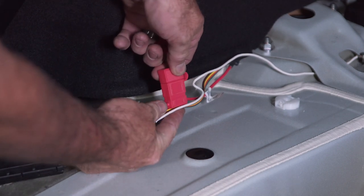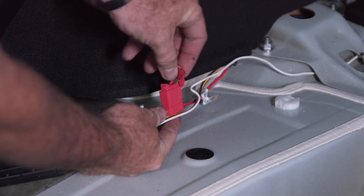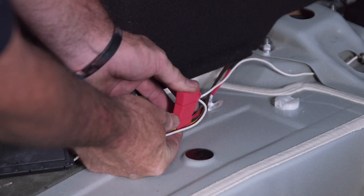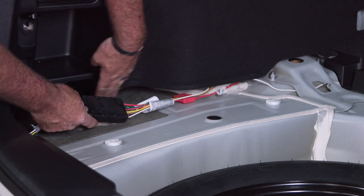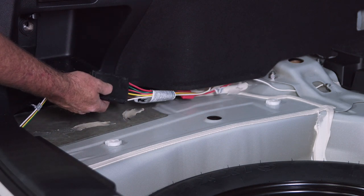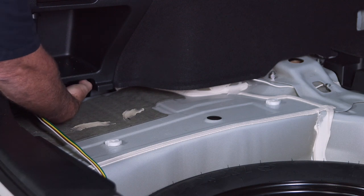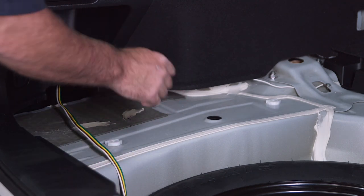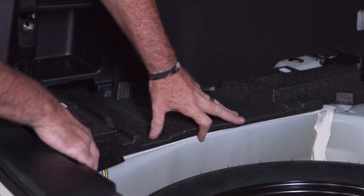To give our tow harness power and get it activated, we're going to put in a 10 amp fuse in the fuse holder — just lifting up the cap, plug it in, close the cap, and our plug is activated. Normally we'd put double-sided tape here and stick it to the wall, but since we're going to be behind paneling, we'll skip the double-sided tape and just tuck it up under here — it's nice and solid. We'll leave our flat harness running right here, and our foam padding will stick right over top of that.